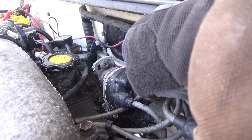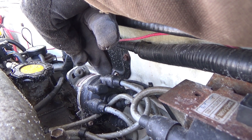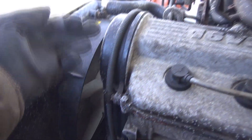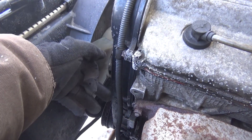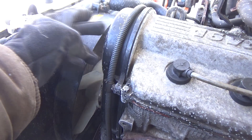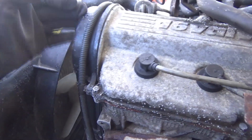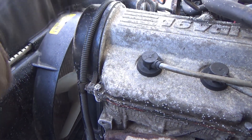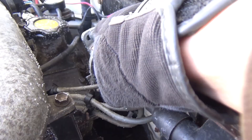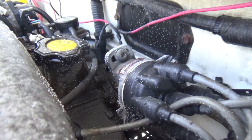Your number one cylinder is here. Your crank should have a dot that points to a slash down there at the top. Your cam should have an E — there should be an E pointing up. Once you make sure that's dead time, then come over to your distributor.